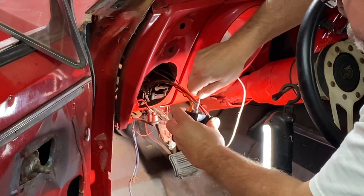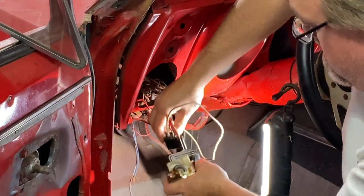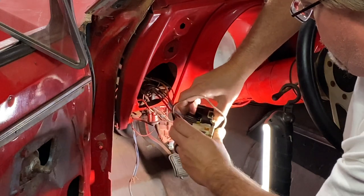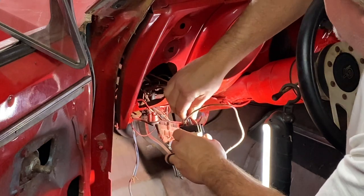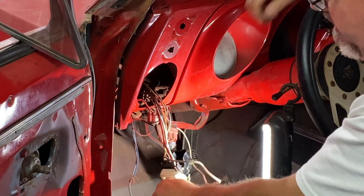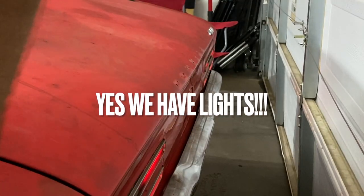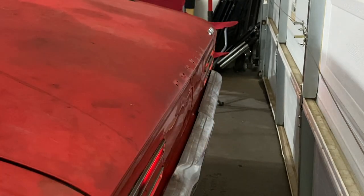So I started going around reaching through, and what do I find — a wire not hooked up. So we decided to go ahead and connect it, stick it in, then take our new switch and plug it in, make sure it's nice and tight down. Let's see if we have brake lights now — the front ambers are on. Let's go take a look out back. You can see we have lights here and over there — let me hit that brake light.